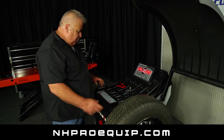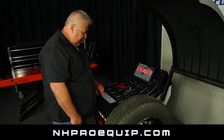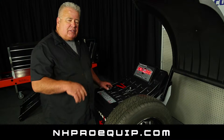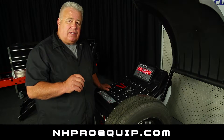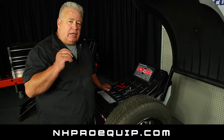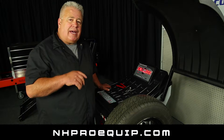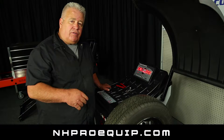In order to get to Cal 2, we're going to do: enter, fine, enter. I'm going to hit enter and then fine, but it's a little different. When I hit enter and then hit fine, we're going to get a beep. The moment I get that beep, I instantly release both keys and it puts me into Cal 2. If I hold it down, it'll jump past Cal 2 and I'll have to start over again.